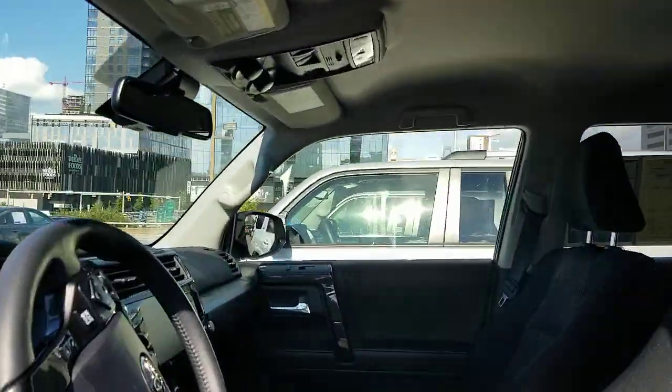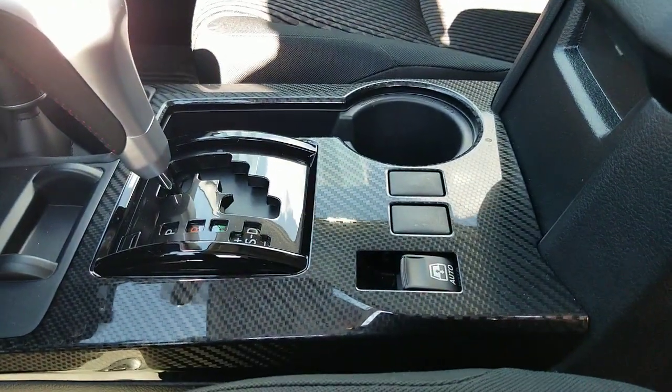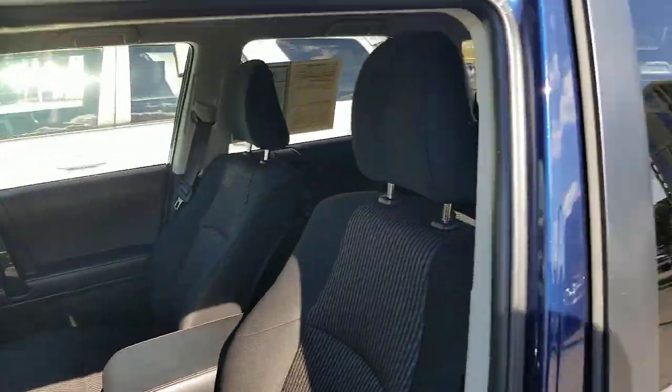If you're trying to turn that windshield wiper on and it doesn't work, all you need to do is lift your window up and make sure it's closed — that will usually fix it. It's not a fuse, it's not something where you're chasing anything like that. More often than not, if it doesn't work, that's your reason why. Hopefully you guys like that — definitely like and subscribe, see what's doing at Toyota, have a great day, bye!